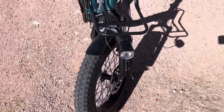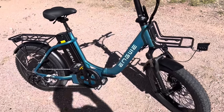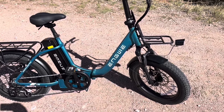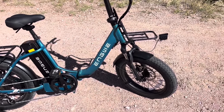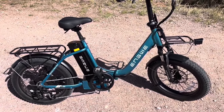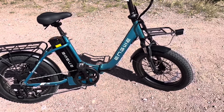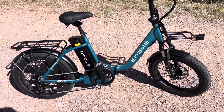And people are coming around to the idea that 3-inch tires instead of 4-inch tires still give you plenty of cushion for the ride, but less mass. More battery life, better climbing the hills, less mass when you're braking, less weight overall on the bike with 3-inch tires instead of the fat 4-inch tires. They're still fat, but I actually prefer the way it corners in gravel.